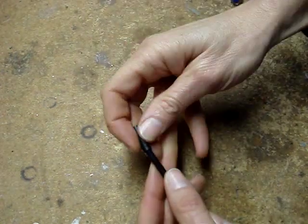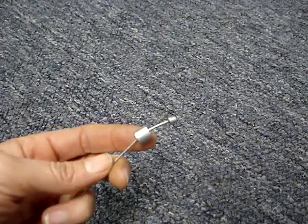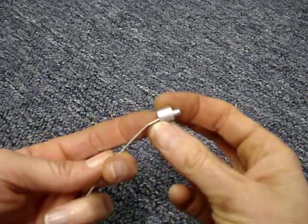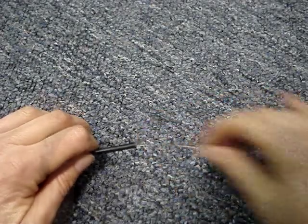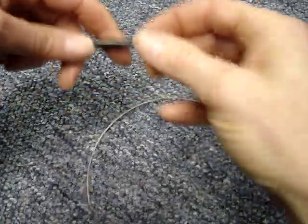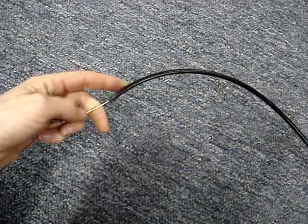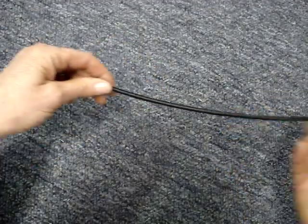Install ferrules on the cable ends. If the housing is inside the frame, take an old cable and some sort of washer that will act as a larger stop. Feed it through the new piece of housing. Feed the end of the cable into the old housing that's inside your tube, then pull the cable and it'll pull the old piece of housing, followed by the new, through your tube.